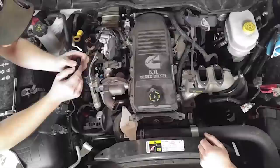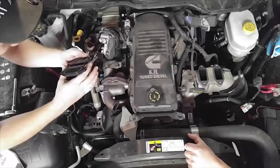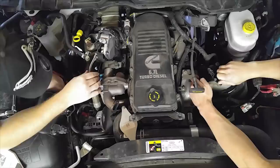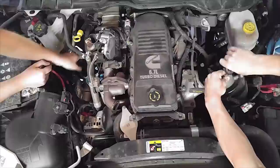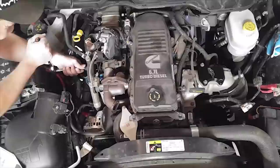Let me explain exactly what the EGR does. It basically just recycles your exhaust gases. When you're driving, towing, or lugging your truck, there's a little bit of soot that comes out of these motors. From the factory they're tuned pretty well so there's usually just a light haze. What happens is the exhaust comes out of the motor through the exhaust manifold, then routes up from underneath the exhaust manifold and into the EGR cooler. The EGR cooler has tons of little vanes in it with coolant flowing through it, and the exhaust gas gets cooled down.